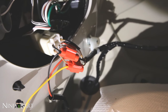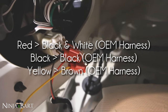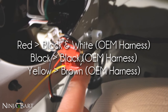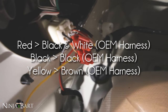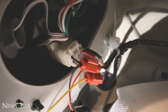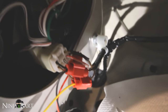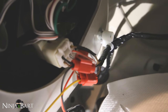To give you a better understanding of the way this works: the red wire coming from the fog light goes into the black and white wire of the brake light. The black wire coming from the fog light goes right into the black wire on the brake light. And then this yellow wire goes into your brown wire on the brake light. You have to be very careful because there is also a brown and white wire, and the black and the black and white wires are a little bit hard to differentiate. So just double-check what you're tapping into. I accidentally tapped into the brown and white wire first, which isn't the right one, so I had to switch that and tap onto the brown wire that is only brown — no other color on that one.